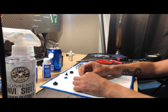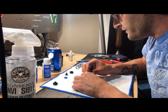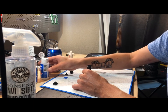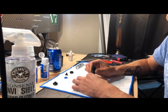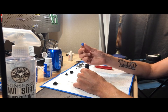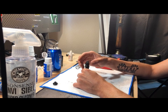What I like to do is compress it and turn it, and as I'm pulling it back out I like to keep twisting it. What this is basically doing is getting all the air bubbles out of it. The more you do this, the more you're going to have to continue to fill it up, as you pull the fluid through the piston holes - they're not going to go straight to the bottom every time. Now that we have all the air bubbles worked out of the shock, we go ahead and cap it off. You take your blue - in most cases it's blue, I have seen white, I have seen yellow - put your little rubber seal back on there, then you take your eyelet, place that on top of the blue seal, and then take your cap and screw it down.